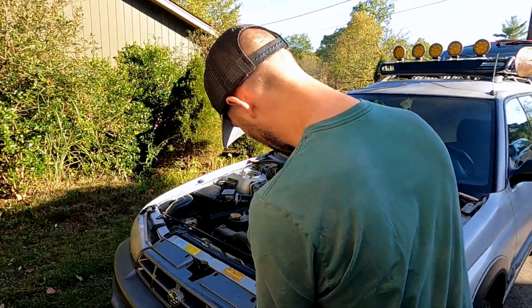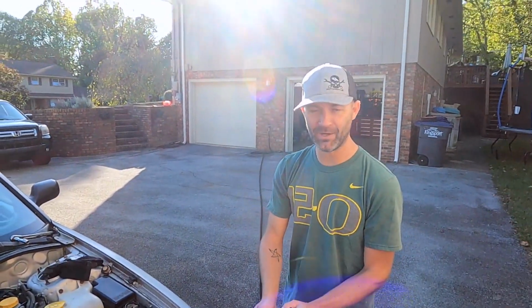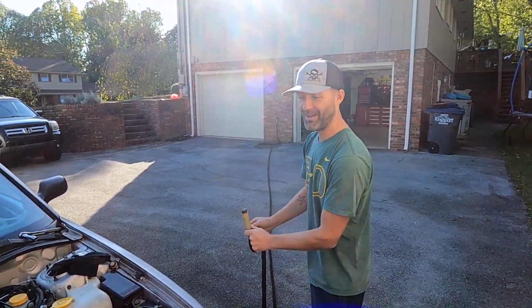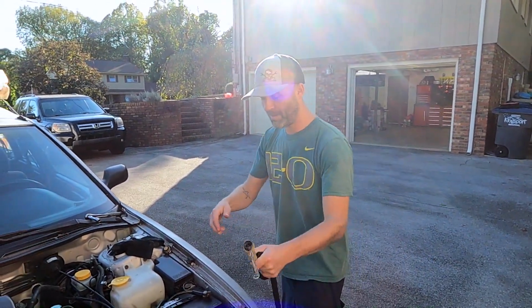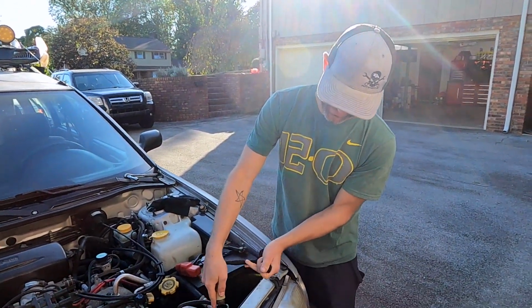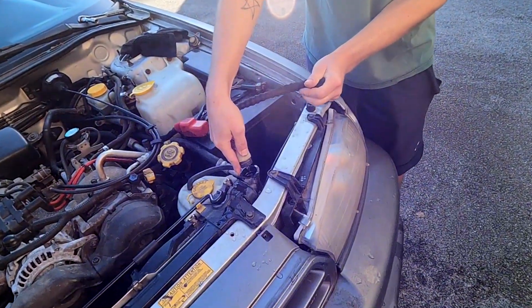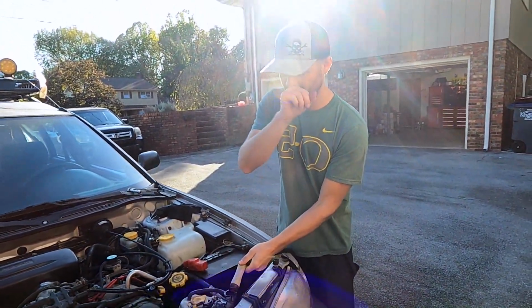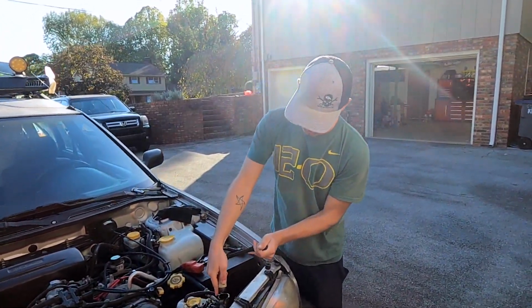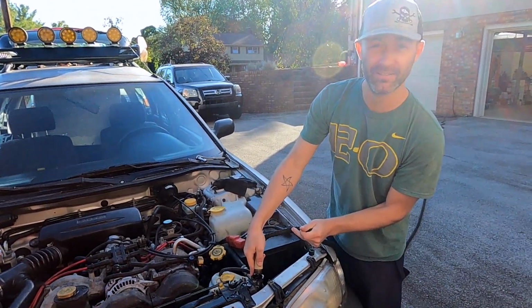All right, Logan, tell them what you did for me. What a good friend. I ran to O'Reilly's and got a high quality $1.99 O-ring for the thermostat. So you just pop that on and we're filling it with this lovely antifreeze. Yeah, that's quality antifreeze, guys. Unfortunately, we don't have our little bleeding system here. I forgot to bring it. So we're doing it the difficult way. We'll have to drain this out anyway, so no big deal.